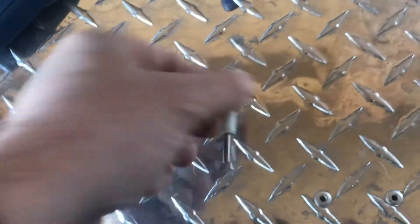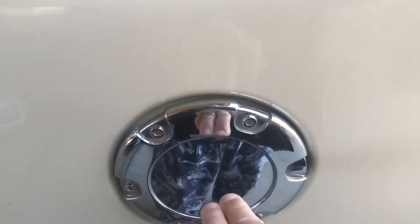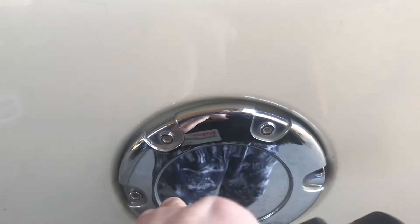I'm going to crawl up underneath the truck. Here's my truck and here is where I fill in my gas. You're going to have that hose — if you look underneath the truck, you'll have the hose that goes off the filler hose and connects to the top of the tank at the rollover valve. I'm not going to take off the bed of the truck or drop the tank. That little blue piece you see is painters tape — I put a Q-tip in there and covered it with painters tape to create some pressure so the check engine light would go off. It's a temporary fix though; you won't be able to fill up your fuel efficiently because the line's not connected. So I'm going to take that off, put the new piece in, put putty over it, and after 24 hours put the hose back on.